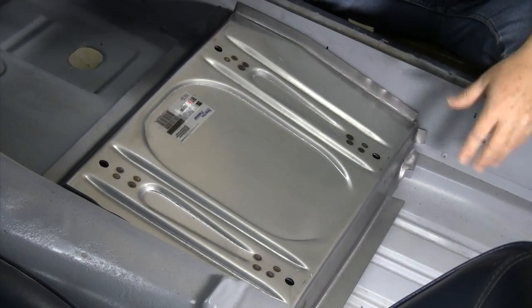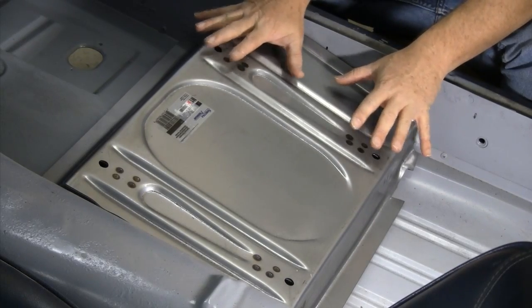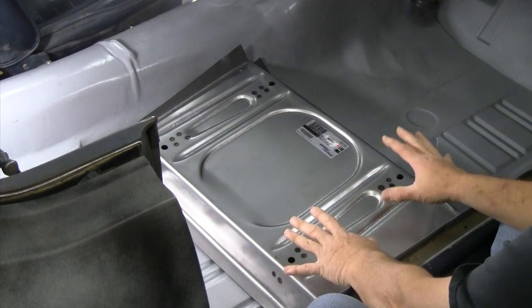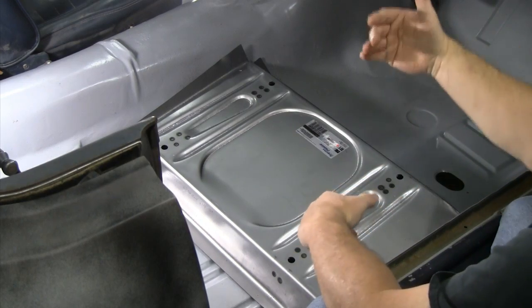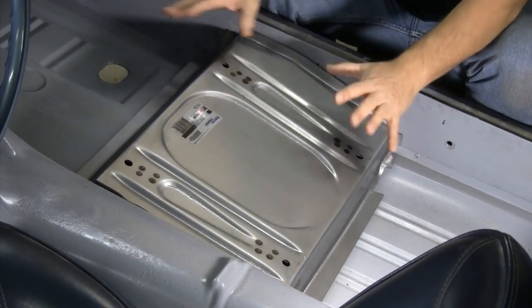You're not going to affect your outside paint or anything except some spots on the underside of the car on the painted undercarriage. Then if you want, you can go back in and repair that, sand it down, and it'll look like new — because basically you're going to do a spot-type weld. Now, some guys have written in and asked, can I just pull these seat pans out of the car? No, because this is a frame-supporting member of the car. These pans actually do a dual function: they add support to a cross brace across the chassis. The tunnel is part of that, as is the seat pan on both sides. So you want to make sure you weld these things in nice and solid to get a good bracing.